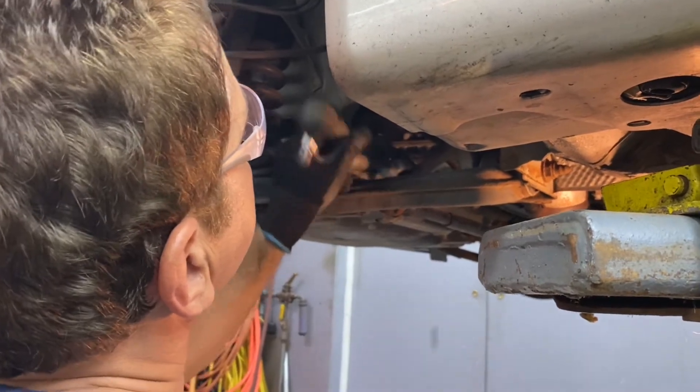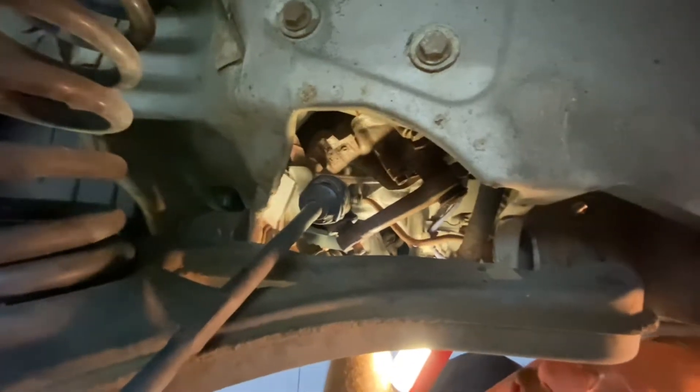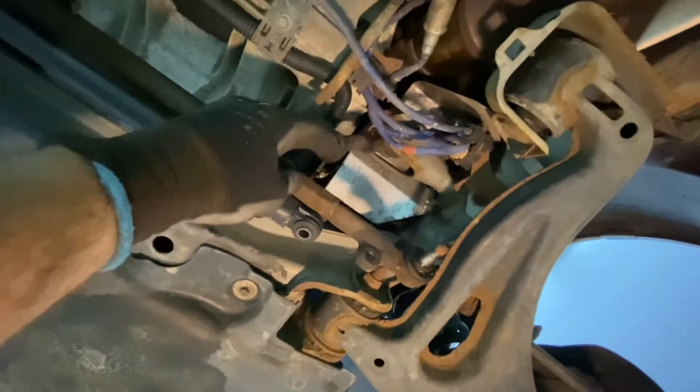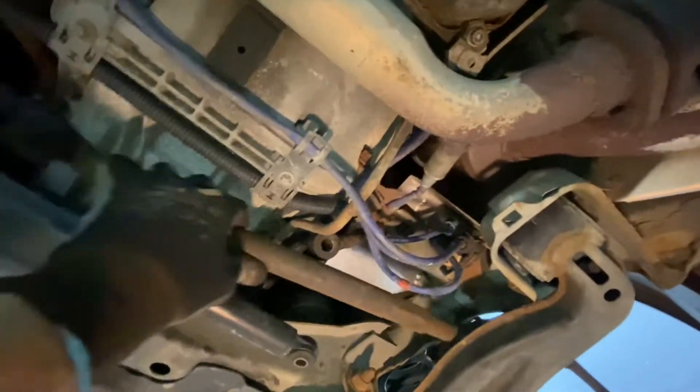Here's the issue — we don't have enough space to push this off. The tie rod end is bumping into the other side. We're going to go in the car and turn the steering wheel either far left or far right to hopefully give us enough space to pop this thing off. It takes some turning of the steering wheel to get it out. We did the idler arm end first — it was easier — and then this side we had to turn the wheel and play around with it until we were able to finally pop the other one out. Now we just need to feed this out through the passenger side.